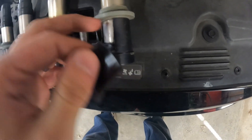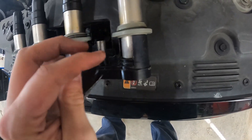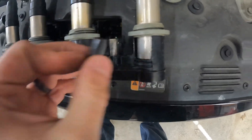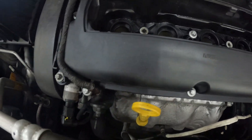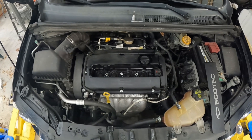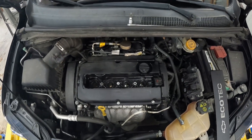It's cracked all the way up to here and I just pulled this out. So it doesn't take much — if it's arcing inside the motor, it's definitely going to cause some headaches, and it was this cylinder in question. So anyway, let me show you the new parts guys, and then we'll pull the spark plugs and get it done.